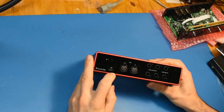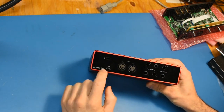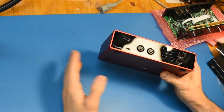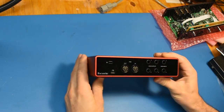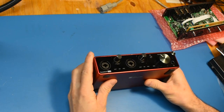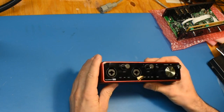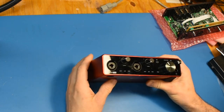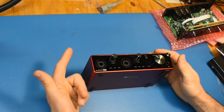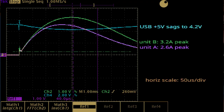It has a USB-C connector but it's still USB 2 and it's just a standard USB device. The 4i4 does draw a lot of current, and that's why even on the manufacturer's website they say if it doesn't work or acts up when you plug it in, try a different cable, a different plug, a different USB hub. I've measured it and indeed on power on it draws a lot of current.